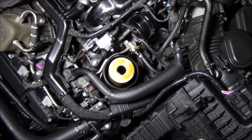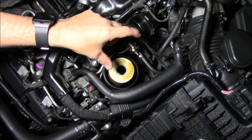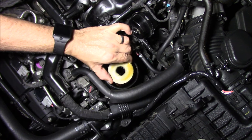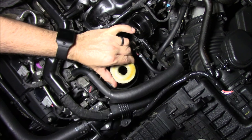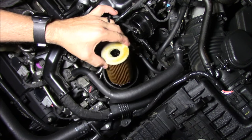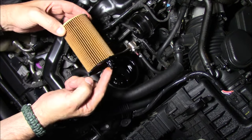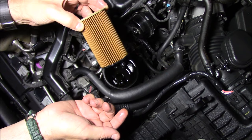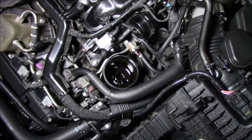The O-ring on the cap needs to be replaced with the new one that comes with the oil filter. Now, the oil filter has a little stud on the bottom — don't twist it left to right, because you might snap that stud off in the socket. Instead, wiggle it back and forth while lifting at the same time. There's the stud — if you twist the filter sideways, you snap it off and have a big problem. There's the old filter out.